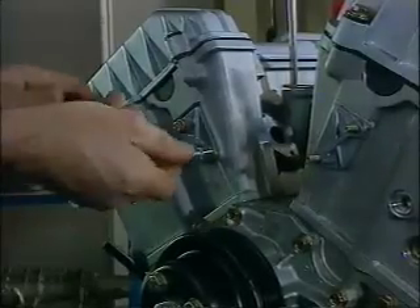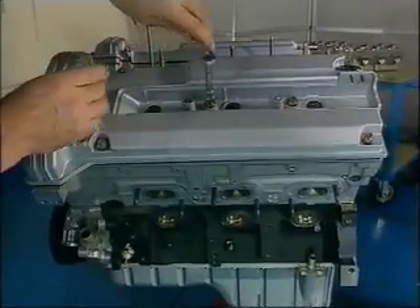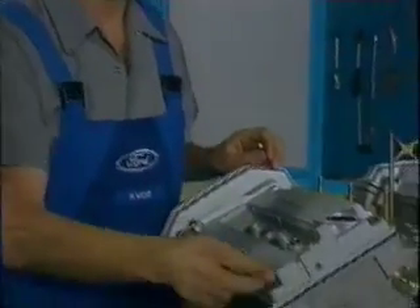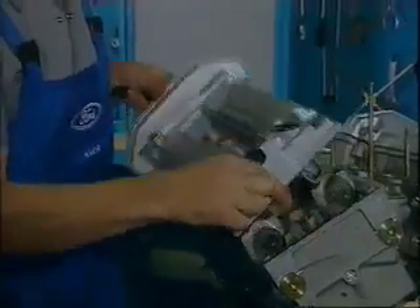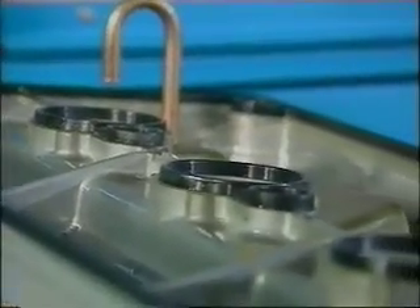If you're working towards the removal of the cylinder heads, you'll need to take off the small covers to the two chain guide bolts, and also the lifting eye on the left-hand cylinder head. This eye must be removed before taking off the cylinder head cover on the left-hand head — if you don't, the cover will snag. Something a bit unusual with the cover gaskets is that they're integral with the cover. Therefore, if one is damaged in some way, the complete cover has to be replaced. To avoid damaging them, make sure a cover you've removed is placed on the bench with the gaskets facing up.